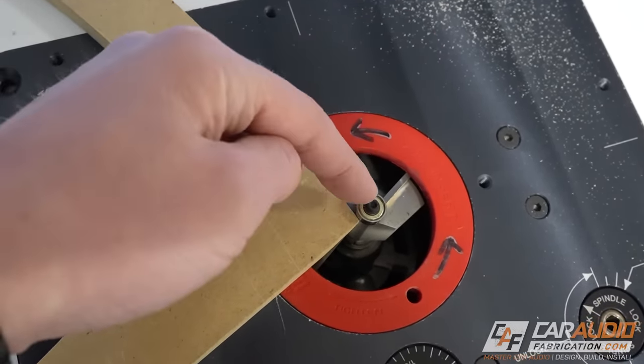The moment of truth — let's see how this all comes together. Imagine this is already installed and sitting in the trunk. First, attach the side pieces with two 10-24 screws on each side. Next, the outer trim ring attaches to the inside baffle piece — these two pieces are now secured together with five different fasteners, making an assembly. Install the subwoofers, then mount this assembly onto the box — held on by 10 different fasteners total. And of course we don't want any of these fasteners to show, so check this out — the magnetic panel just snaps into place.